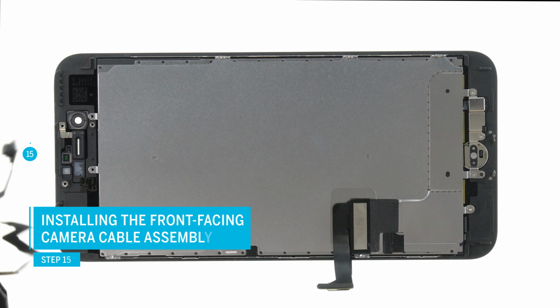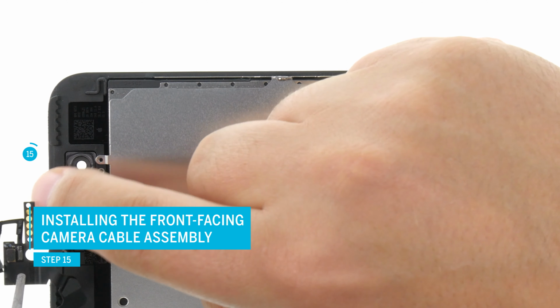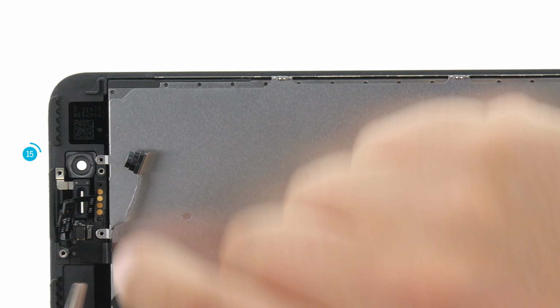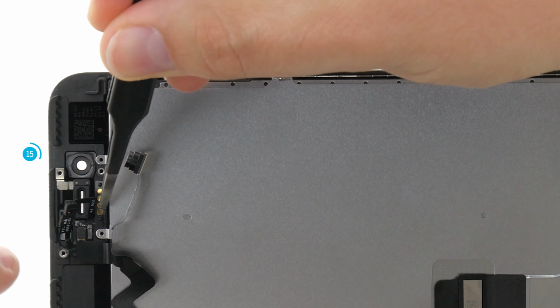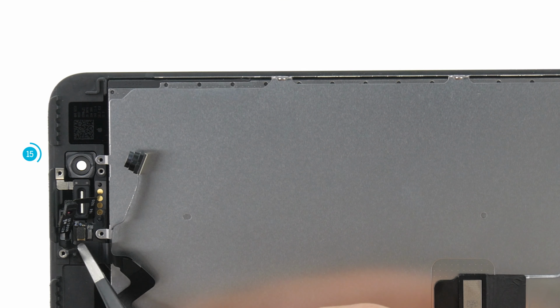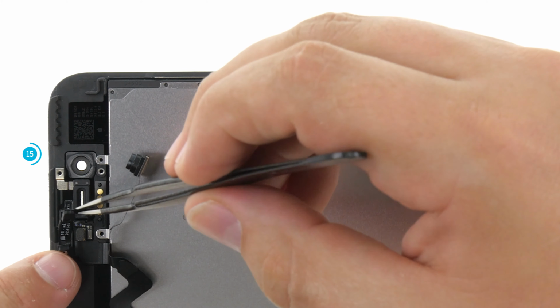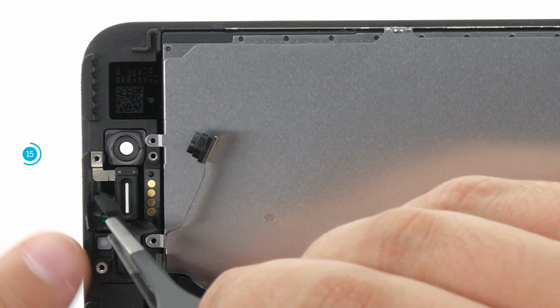Now attach the front camera flex cable again. Start with the 4 gold contacts for the earpiece. To the left and right of it there are small openings that have to be led to the little tips on the display. This will help you to position the flex cable correctly. Then place the microphone in its opening. Fold the proximity sensor over and place it in the transparent holder.